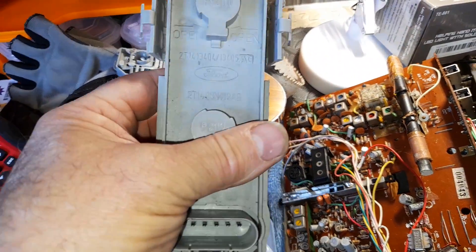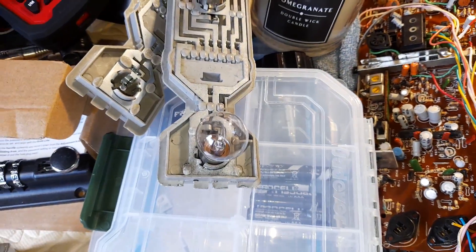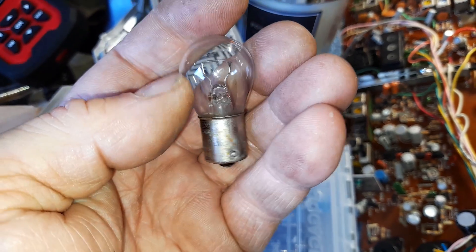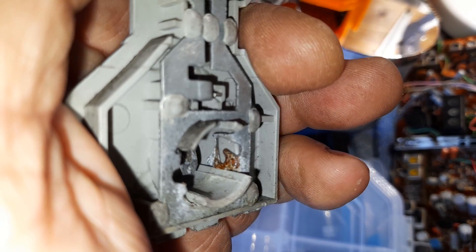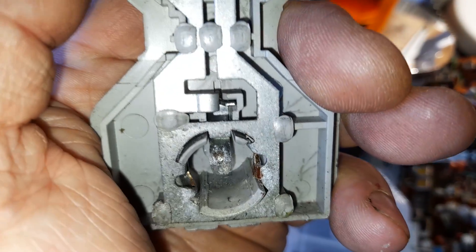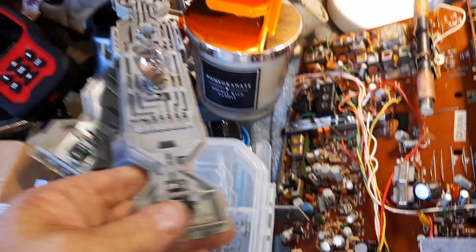Here is the original Ford one - it even says Ford on it. This is the one that was in there. Now the fog light is obviously this one and the bulb hadn't gone - don't be stupid - because the new bulb's out of here. So I took it apart and, as it always is, Kaz was completely and utterly right again. See the corrosion on there - there's a trace of rust and a layer of like limescale all the way through. Now as we look inside, that little hook is where the pin goes in and locates. The tip in the centre of your screen is the positive conductor, and then you've got the negative conductor on the outside which wasn't negatively conducting because of the rust. Rust got in the way, created resistance to a point where the lamp wouldn't work.